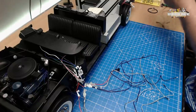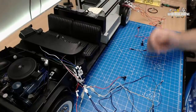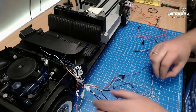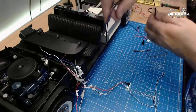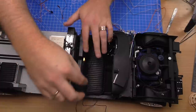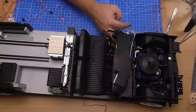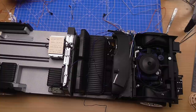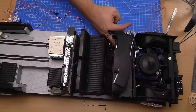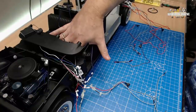So theoretically when I turn the lights on - I'll put these around here so we can see the lights. Only one light should come on which is the interior light, because all the doors are open and none of these switches are activated. The power switch is just down here - turn it on. We got something! The blue and black leads have come on, so I'm guessing they are interior lights. I'll stick them in the middle there. Now it wants us to test the brake lights - I'm guessing these red ones. We've got two lots of brake lights! This one and this one here - when I press the brakes, you can see the brake lights come on.